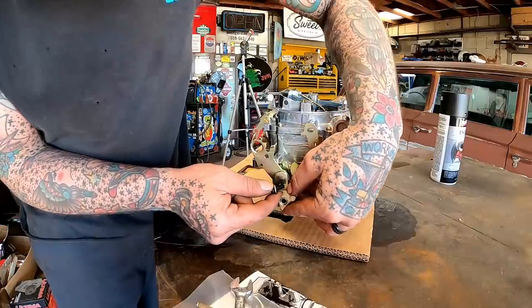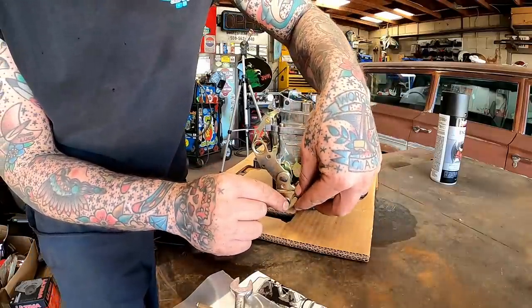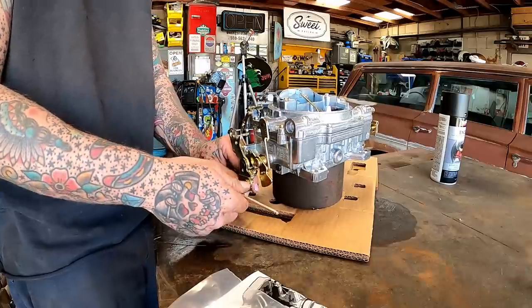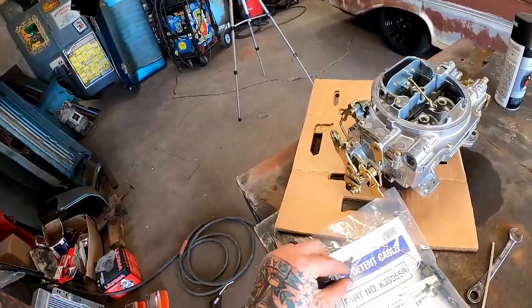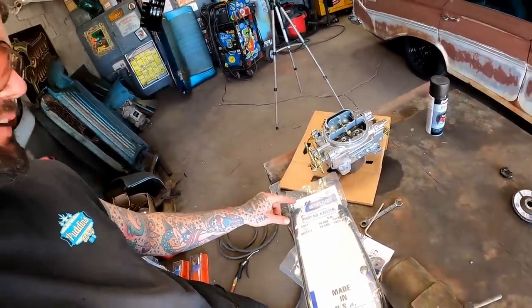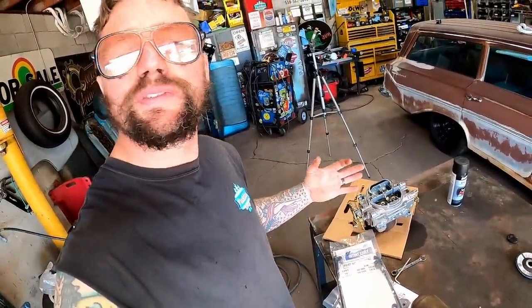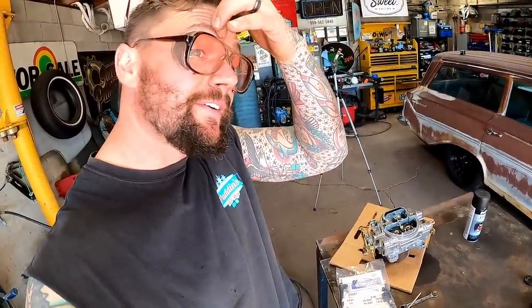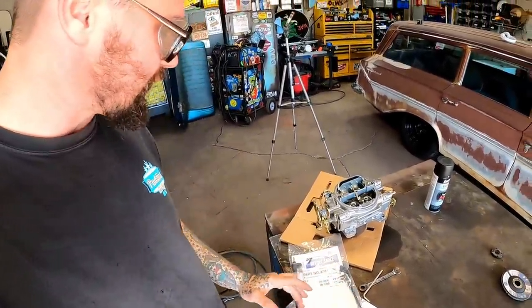And that appears to sit right there. That tab's gonna interlock it. Ooh, lock her down. That is what this is going to end up clicking onto, and that's going to control our transmission on a 700R4. This controls everything, the amount of fluid flow and shifting, all kinds of important stuff. So if this is not set up properly, you're going to have trouble.